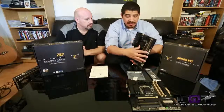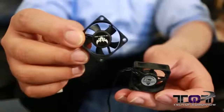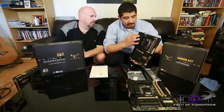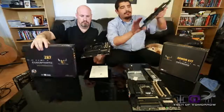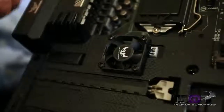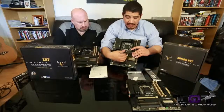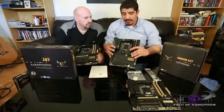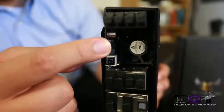There's a lot more validation and reliability testing that goes into that, and that's part of the reason why the Sabertooth series of motherboards offers a five-year warranty. Going back to the thermal armor, it's pretty consistent from the previous generation. We have the two assist fans that we incorporate, where we have what's called the GPU zone and the CPU zone. One fan goes here and another one goes in this section. I'm going to bring out another board where I already have them mounted so you can check it out. You can see right here in the centralized area how it's set up — it brings in airflow to cool the board in this section where we have our graphics cards as well as the PCH area, which provides all the I/O and information delivered to the SATA ports. In the VRM section, we have another fan which can serve as an intake or as an exhaust. So you've got a lot of flexibility, and of course these fans, like every single fan header on the board, are fully controllable in both our software and the UEFI environment.